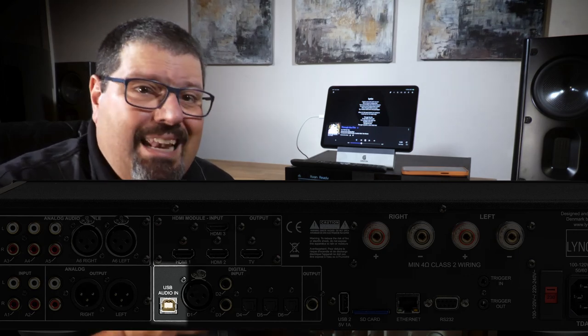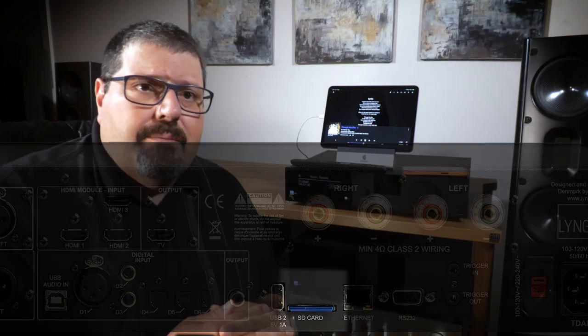The 3400 also has a real audio USB input, and both the USB and HDMI inputs support DSD up to 5.6 MHz. The USB port on the 1120 is for file-based playback only and saving and restoring configurations. The 3400 has a built-in SD card for storing and recalling configurations. And finally, almost everything can be configured directly from the built-in dynamic display using the remote control without any need to actually enter the web interface of the device. This is something not possible to this degree with any other of the Lyngdorf audio amplifiers. The display is also very easy to read, even from a distance.